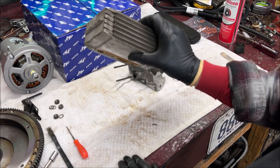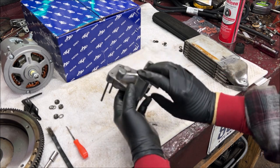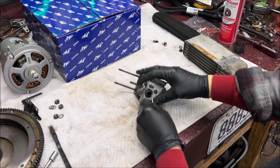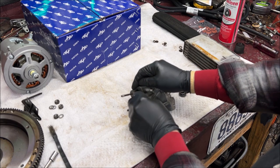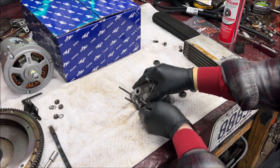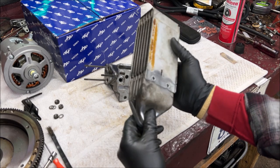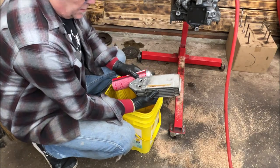I cleaned the surfaces up — it's sitting inside and nobody's going to see it anyway. Once you put the fan shroud over it, you're never going to see it again. Let's take a little pick or screwdriver and get these seals out. You have four of them. These ones were smashed pretty good — it might have been over-tightened a little bit. We'll go over the torque specs in a second. I'm going to clean out here and here, but first we're going to flush this out. I want to make sure there's not a lot of dirty oil or sludge in it. I'm going to spray some brake clean inside of here.